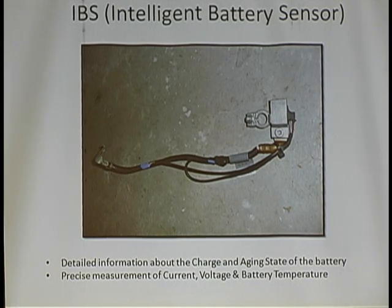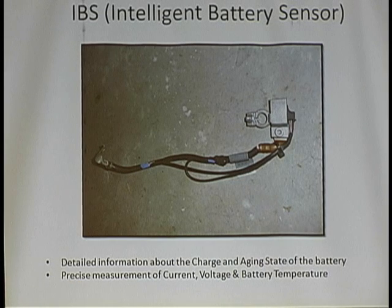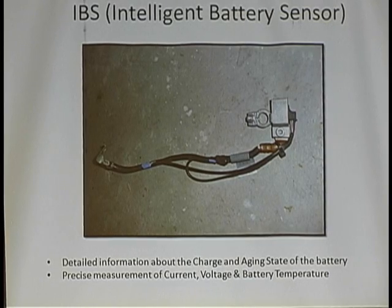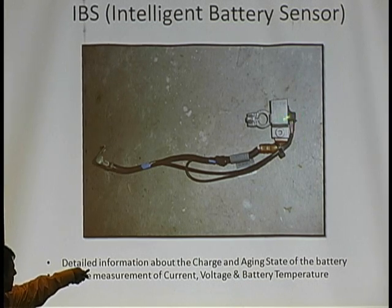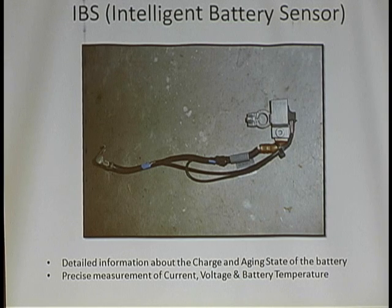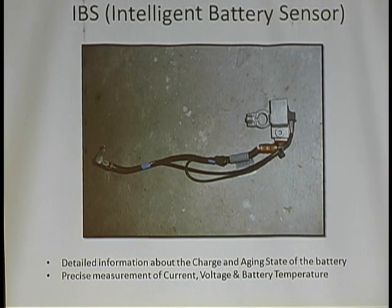Where was I when this all happened? I was probably sleeping — nobody woke me up. Here's the thing: you could miss a class and miss information. It's about staying in class and continuing to learn. And this little sensor here took out the whole system. It can also bleed a minute amount of voltage into that wake-up line and keep all the computers awake even with the key off — and kill the battery. The guy says, 'My car keeps dying overnight' — because everyone's having a party through the night.